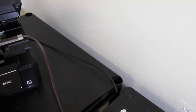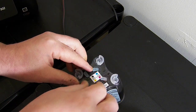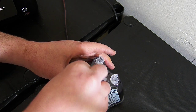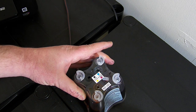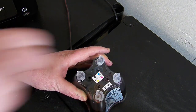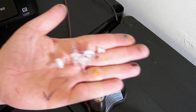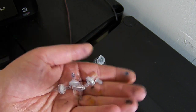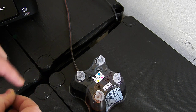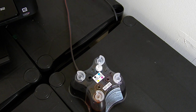On top of the continuous ink system there are four small flat plugs in the middle — you need to remove those. What you're going to pop in here are some air filters. The purpose of the air filters is to allow it to breathe; if you don't put them in, no ink will come out onto your paper. Within your accessory pack there are some air filters — they have a narrow pointed end and a short stubby fat end. They should be inserted with the narrow pointed end facing upwards. Pop one into all four of the inner holes.